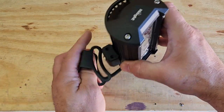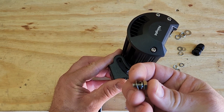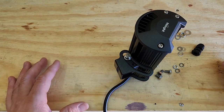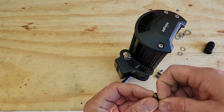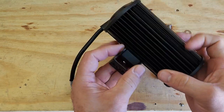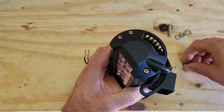First thing we're going to do is get our bracket mounted on the light. Make sure you have it the way you want it so you don't have to mess with it too much - this gives us a lot of adjustability. You take the bolt with the lock washer, then the flat washer, and just put it in there - do that for all four of them. We'll snug them down a little but not too much because we want to make adjustments later. Then we'll go figure out where we want to mount this, probably center of the door for equal light coverage.